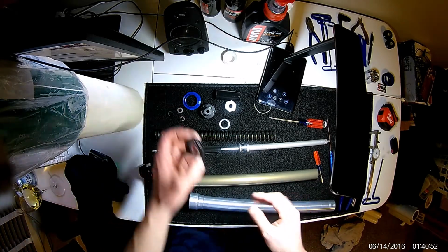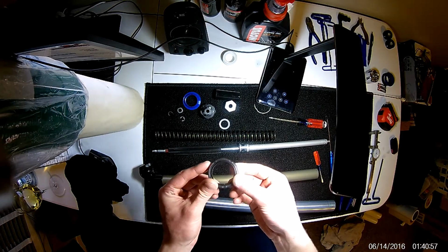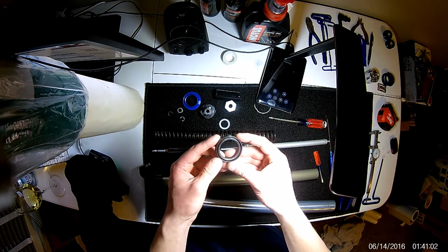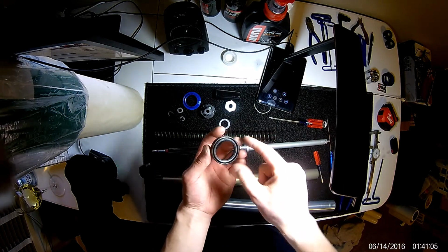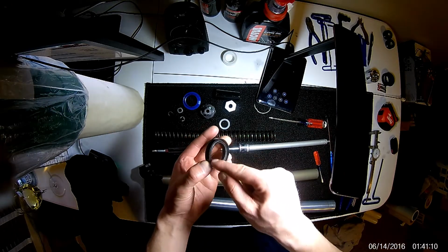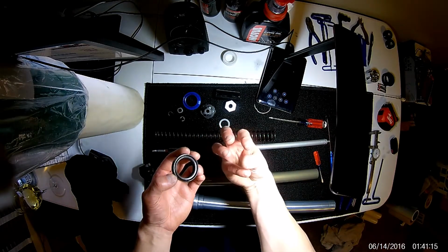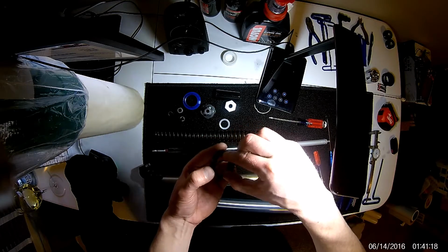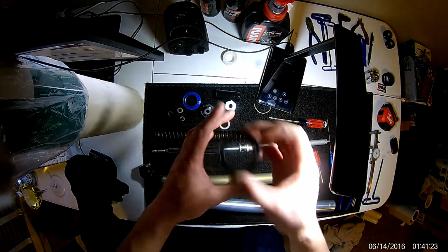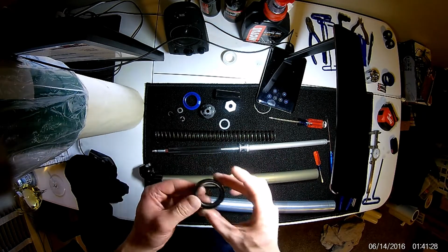Now, for driving the new seal in, one of the most important things is that the seal is directional. You can see here we have a flat face with a little bit of a ridge coming out, and if we turn it over, there's a recessed portion down in there. Down in there is a coil spring that wraps around the circumference of the seal, applying constant tension in on the seal. That's what gives you your seal characteristics. Otherwise, if it was just rubber, the rubber would wear away and you'd leak oil. This always has tension around to make the best seal possible.